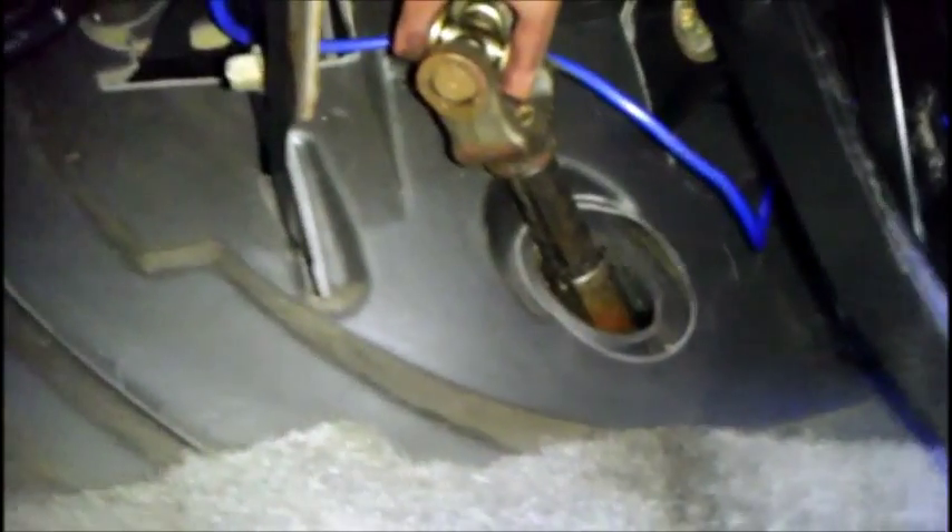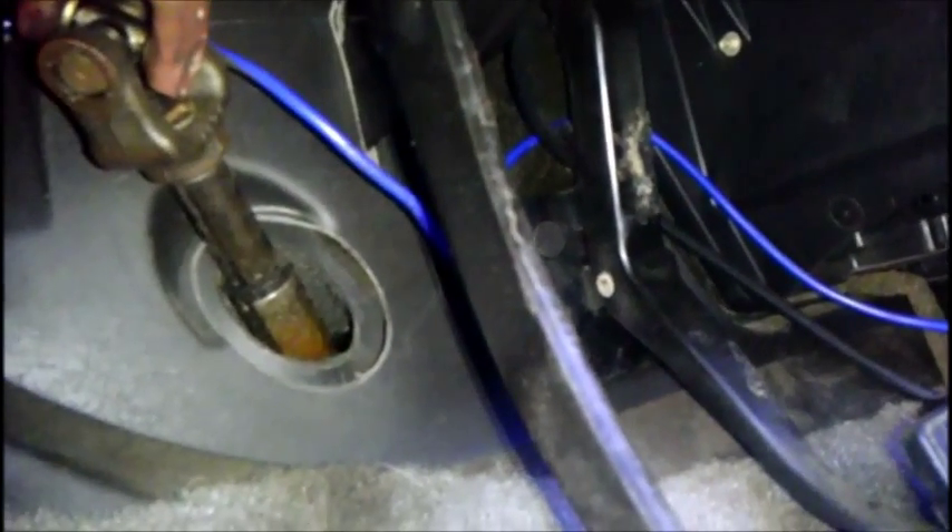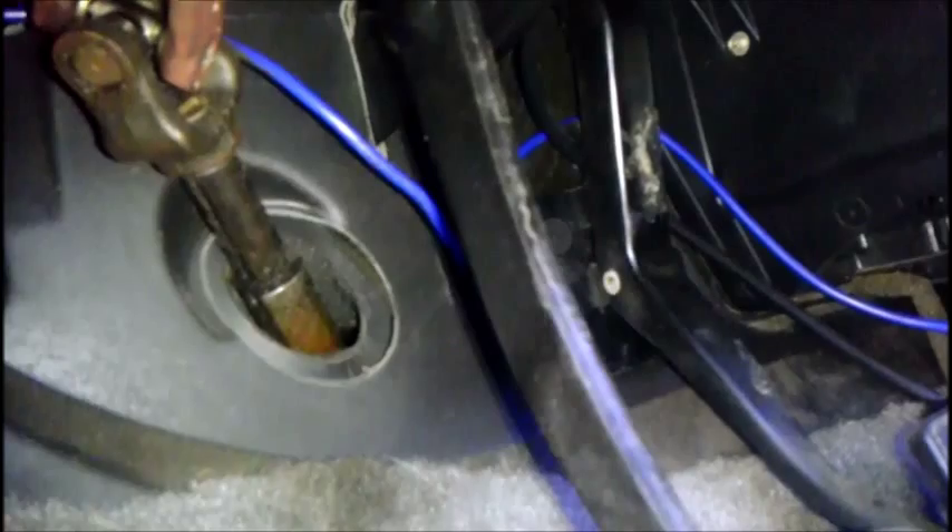Just so you know, because the F5 issue does involve kicking the radio power and the power adapter in the butt, what I did — this blue wire was for my relay project, which I will go over in a couple minutes. I ran this wire back behind the steering knuckle here and behind the accelerator. Just as a fair warning, you may want to test drive this configuration a few times, just to be sure that you do not nick the wires in any way to prevent short circuits. After that, you should have easy access onto your radio trim.